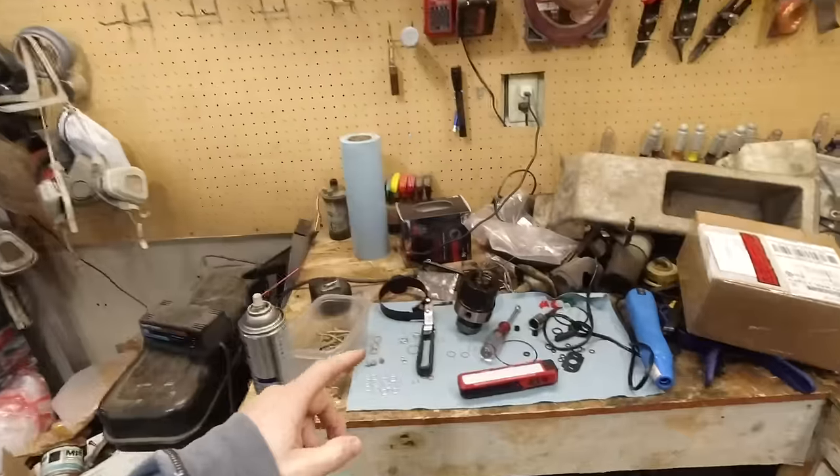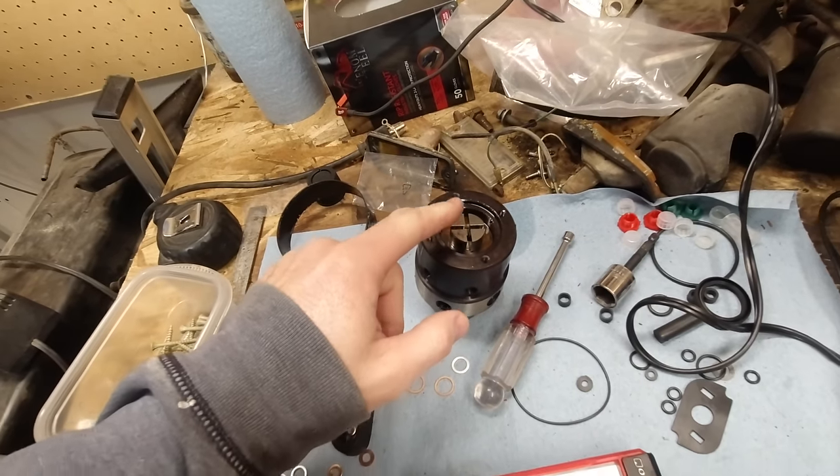And it's taking up a lot of space, so I just want to be done with this. So that's where we're at now. I got this tightened. It does not take much. This nut came with a spec: it's 11 inch pounds of torque. It's basically by hand. It doesn't take hardly anything. So I got that tightened. We're good to go there.